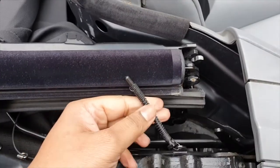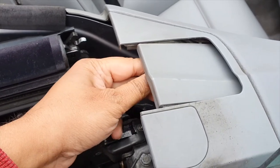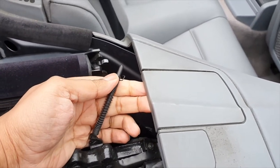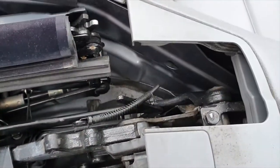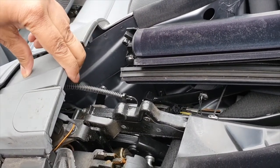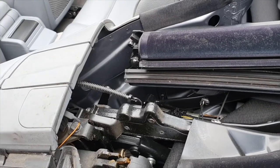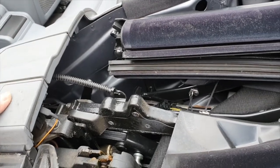So that's probably going to save me a bit of money, but the thing is it's not hooked in. You see this hook — it's supposed to be hooked in underneath here. When the roof goes down, this gets pulled out by the spring, and when the roof goes back up this pushes it forward, and the main struts for the roof come through that gap. On the working side you can see it's all connected nicely, the spring is hooked in underneath.